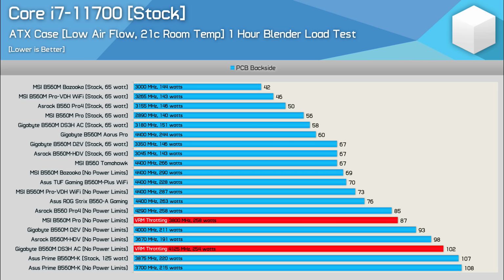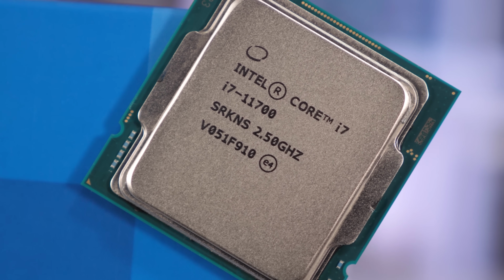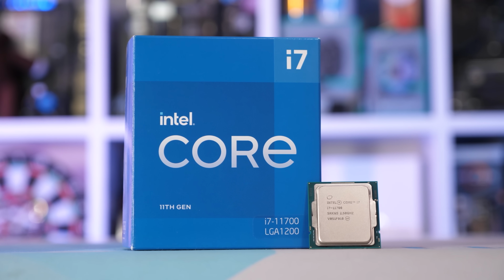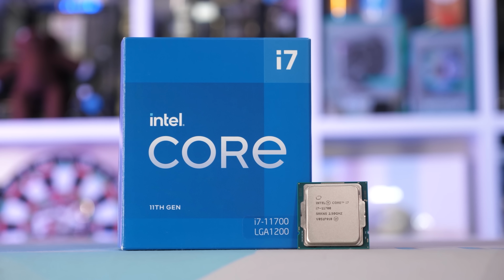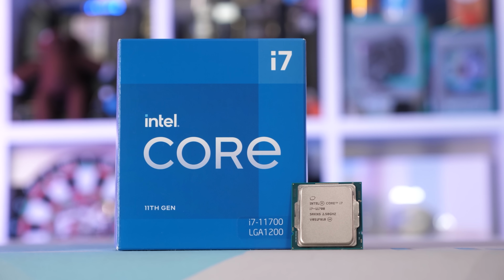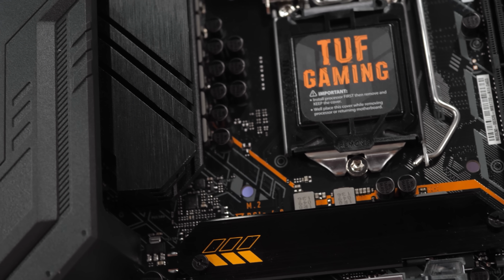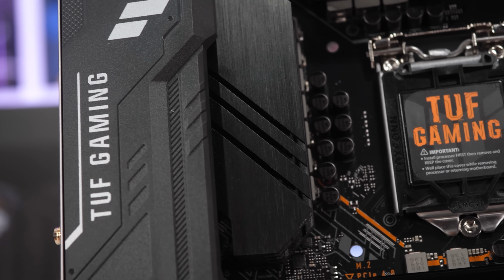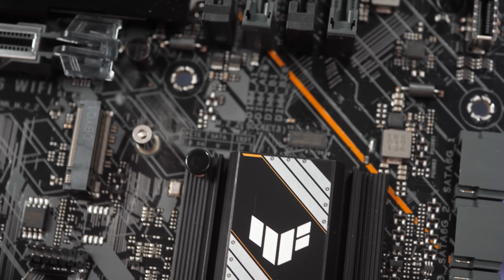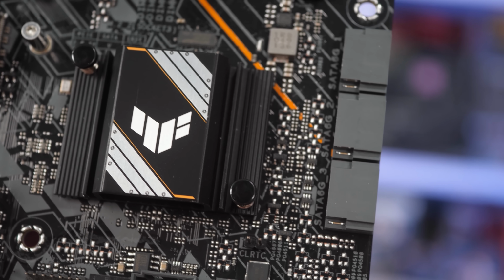It's also worth noting that on an Asus, MSI or Gigabyte Z590 motherboard, the out-of-the-box performance between the 11700 and 11700K is within 5%. Now, I'm fully aware that most people spending $390 on the Core i7 11700 or $340 on the F SKU will probably be okay spending more than $100 on their motherboard, and would probably opt for something like the $150 Asus TUF Gaming B560M Plus Wi-Fi. Likewise, those spending $400 US on the Ryzen 7 5800X probably won't be looking at the Gigabyte B560M D2V.